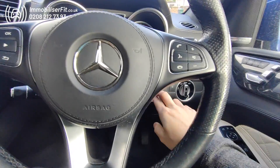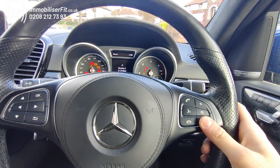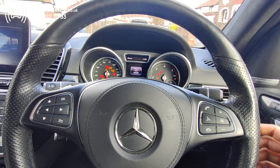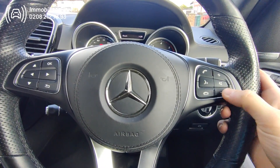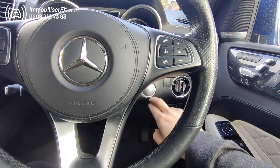First of all, you've got to disarm the system. We'll do that with a push sequence. If you have your old phone there's no need to. The code is one, two, three — you'll get the melody. Now press any button you've used for the code seven times: one, two, three, four, five, six, seven. Then turn the ignition off and back on.